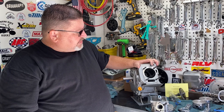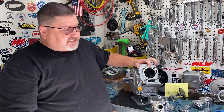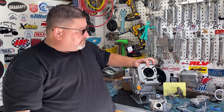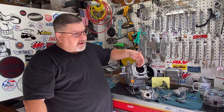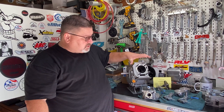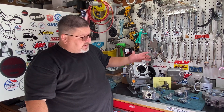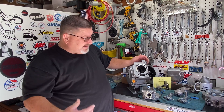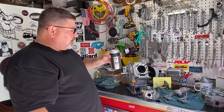So even if we're 17 thousandths in the hole, I'm going to use a 10 thousandths shim head gasket, and that's going to give me 27 thousandths clearance between the top of the piston and the bottom of the head. Obviously I'm going to have to measure that once we get everything together, but we'll be real close. If I have to stack head gaskets I'll use two 10 thousandths head gaskets to get more clearance — I'm hoping not to, but if I have to, I will.